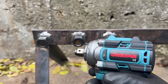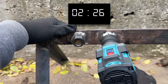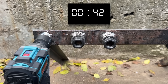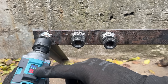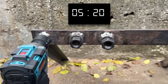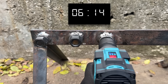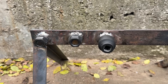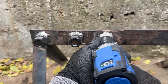So I reached over and grabbed the AliExpress tool. The footage isn't cut, so you can see everything for yourself. The OneVan managed to remove all three nuts without a problem. Since I already had it at hand, I switched it into forward, selected mode 3 — its highest power setting — and hammered on the three nuts for a couple of seconds each. I then grabbed the LuxTools stubby to see how it would cope against the AliExpress tool, and in the end, it didn't even break a sweat.